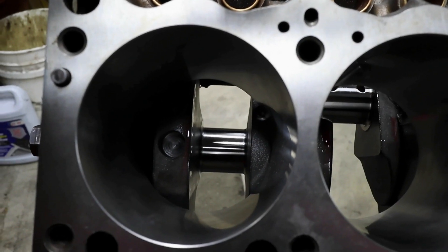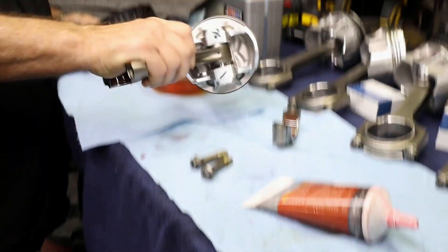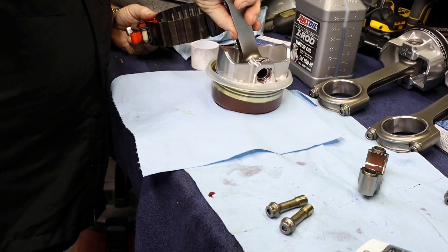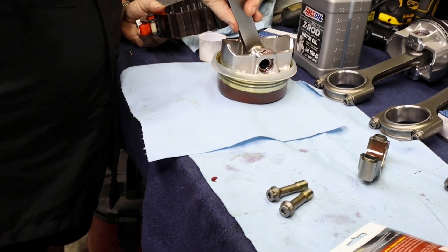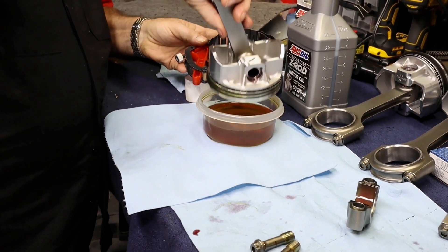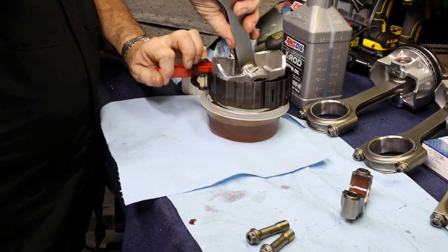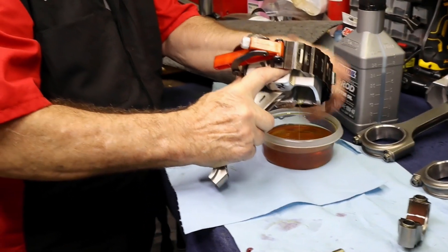That journal is in its bottom-down position, respective for piston number one. Taking our oil — it's going to be messy — we're just letting that soak into those compression rings. Making sure those are good and saturated. We're trying not to be as messy here, but there's really no way to do this cleanly. We want to make sure that all the gaps in the rings are compressed as needed.